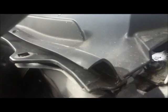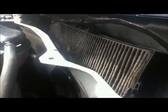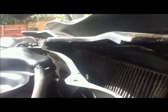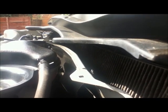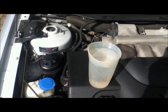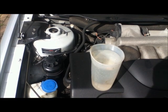I've managed to pull that seal out now, and you can see under here this is actually pretty wet — see how much water is coming out of that bit of rubber. The pollen filter really does need some work. But what I can't see is how the water would actually get down into the engine bay in order to get onto the ECU. I'm going to do a flood test and see where the water actually goes when it pours down the windscreen.